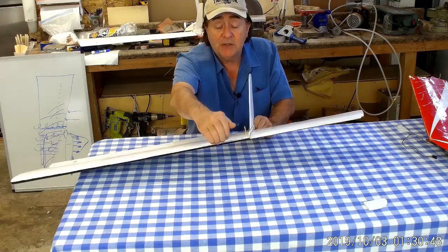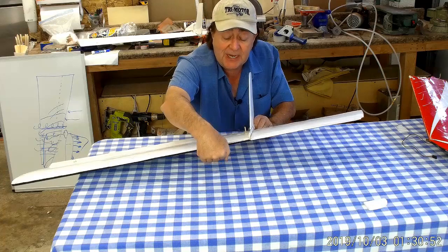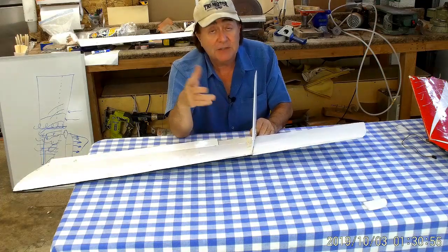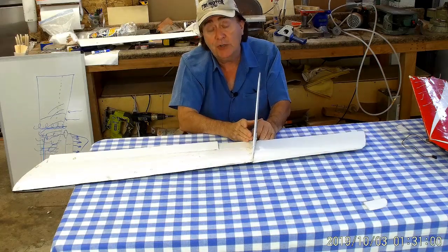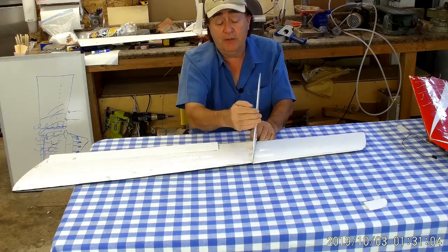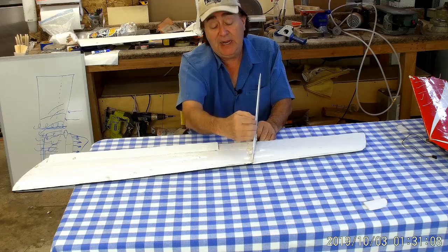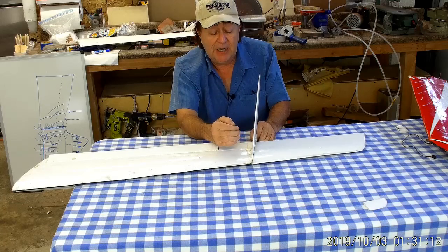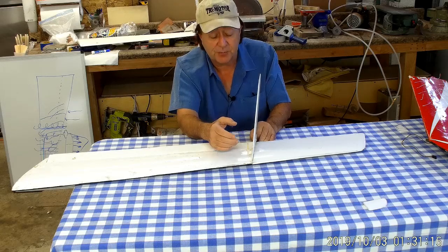You'll see that when wings are at an angle of attack and somebody draws the streamlines, they're actually angling up slightly before they get to the wing. And that's just the nature of incompressible flow. So I can position this winglet aft and still straighten out the flow in front of the winglet, ever so slightly. So aerodynamically, this winglet actually is a little further forward than what it appears to be physically. Just taking advantage of the nature of incompressible flow that way.